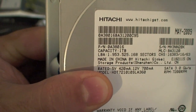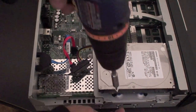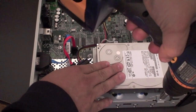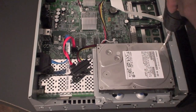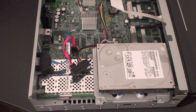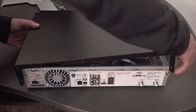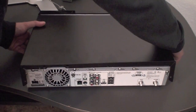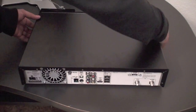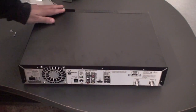I wanted to show you that here is a one terabyte drive so you can see that is the right size. Put it back in and basically put all the four screws back in place. Once you are done, go ahead and connect the SATA cable with the power once you put all the four screws in. And that is it — you are done. Now go ahead and put the cover back on. Take your time putting this on because there is some play to it. Once you get it right, just push it into place and it will be nice and snug and lock in place. Then go ahead and put all the screws back in place.